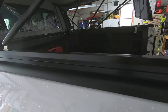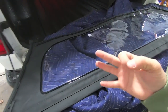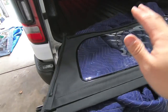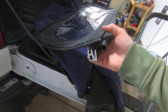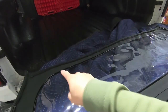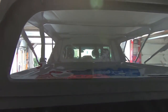Every rail has its own little sleeve that attaches to it so everything stays nicely situated. I went ahead and did all the velcro on each of the hoops that go across the width of the bed. Now we can turn our attention to the rear window. You should have three vinyl windows in the kit — two side ones and the rear. You know it's the rear because it literally looks like the back window of a pickup truck. Once you separate it, grab the front rail and slide it right onto that rod and fabric, which is how the aluminum bar attaches to the bottom of the rear window.